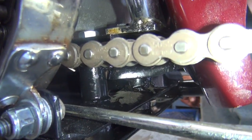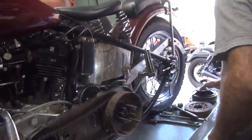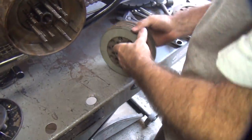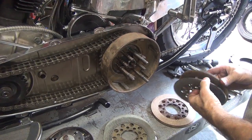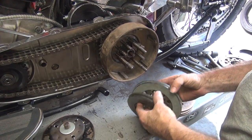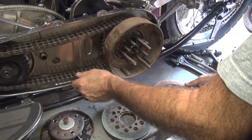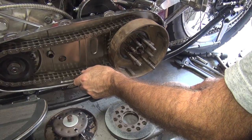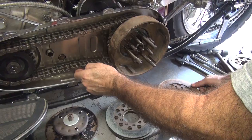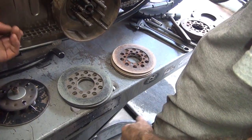So what do you think about this primary chain? Is it any good? It's used — it'll work. It'll work for you. You should have heard about the rear chain. I'm starting to tighten it up now. You've only got an inch and a half of free play so you're almost there. I can see the chain moving. Is there any drag on that nut? It's a slight. Okay, it's the same drag as the other drag. I've got to go one more. Stop. Okay, that's about where it should be. Until we turn the motor over, we don't know what we need yet. Leave it at that.